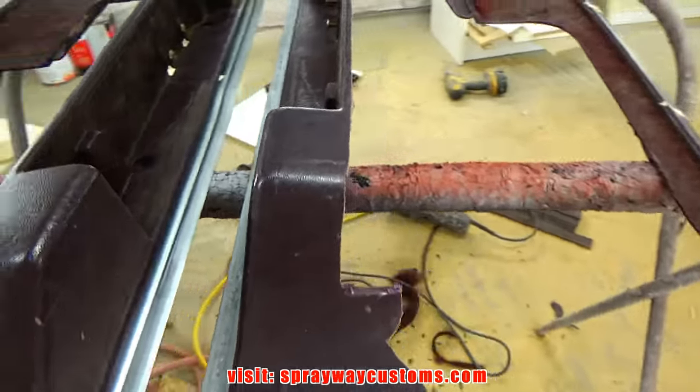Fiberglass goes inside these staple lines. Like this here, I don't gotta fiberglass that because it's wood. And here's the resin I'm gonna be using. It's the fiberglass resin by Bondo. I got a cup, chip brush, and the hardener. I gotta get a stir stick. And I'm just gonna be brushing it on. Then I'm gonna let it sit out here overnight, then I come back and sand it down. It done got late in a way, but I just want to put the resin on before I finish up.